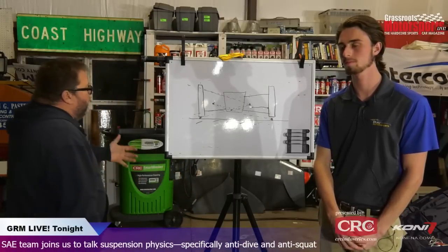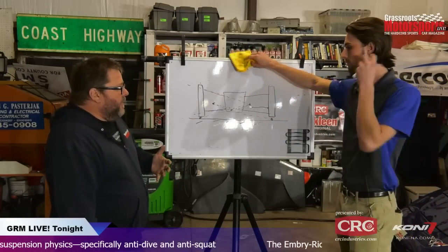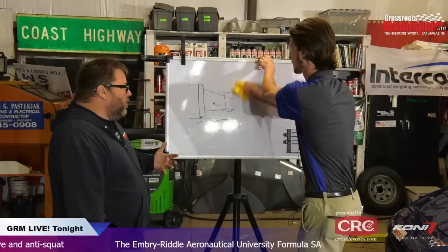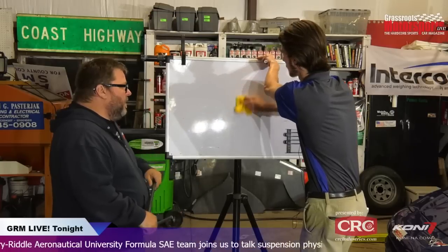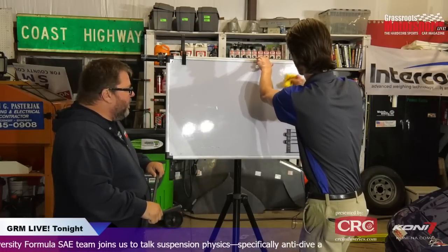Anything we can do to leverage your giant brains and teach our viewers more stuff, I think it's going to be awesome. So, all right, let's talk a little bit about anti-squat in the front, because I would think it is going to affect things like braking performance. Yes. Or especially a front-wheel drive car. Not too many front-wheel drive cars with A-arm suspensions, except Hondas, really. But that's going to be a fairly large effect.